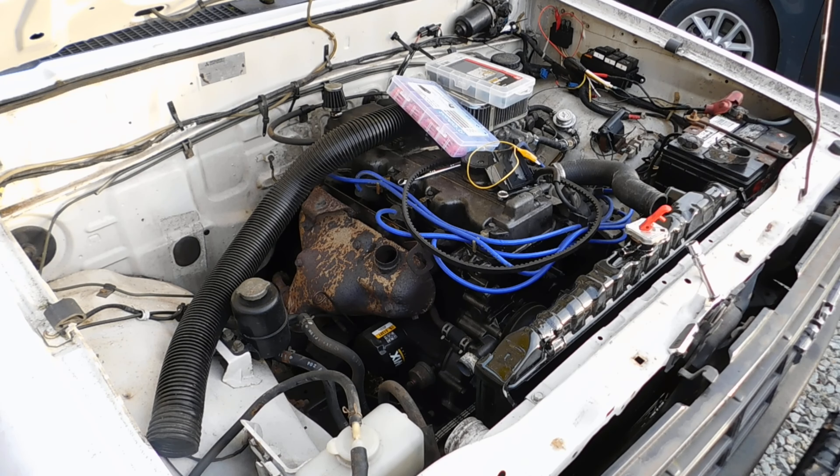It's wet above the fitting — I think that's where all the water's coming from. Driving around finally got it hot and got it up to pressure, so driving did open the thermostat. I want to change the thermostat — I don't trust it. It's one of those stupid safety stats from O'Reilly's that are known to fail all the time. The unfortunate part about it being a safety stat is they're supposed to fail open, but every one I've messed with fails closed, and half of them are dead on arrival failing closed.